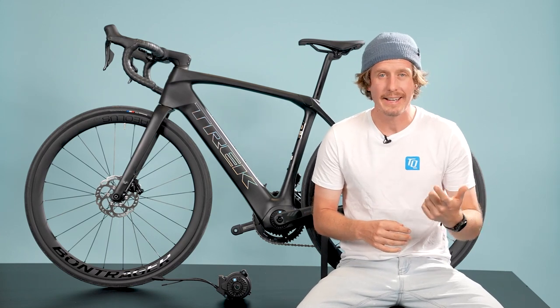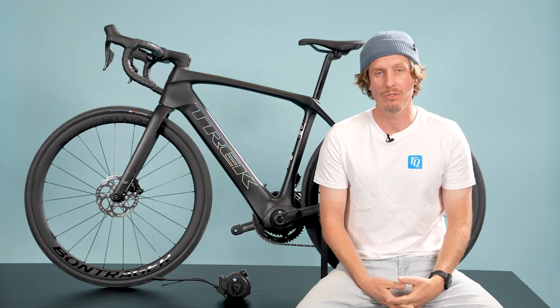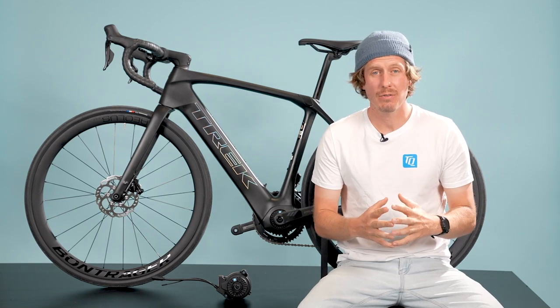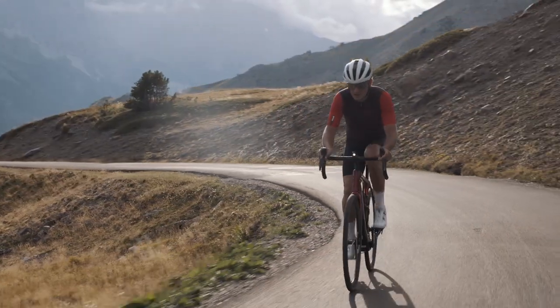Combined with our passion for cycling, which runs through the whole team from production to engineering, we have the perfect mix of tech nerds and bike enthusiasts. These two components allow us to place the needs of cyclists into the soul of our work. Our innovative TQ HPR50 e-bike system consists of the HPR50 drive unit powered by our patented harmonic pin ring transmission — the heart of the whole system. Natural 50 Nm and 300 watts of peak power will provide the right push to get you over steep and long climbs while never feeling disturbing or overpowering. That, complemented by a 360 watt-hour battery and 2-inch fully integrated display, makes the lightest e-bike system, weighing in at just 3,900 grams. You will feel like you are riding on the fittest day of your life and forget you're sitting on an e-bike altogether.